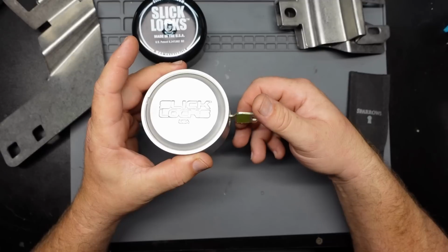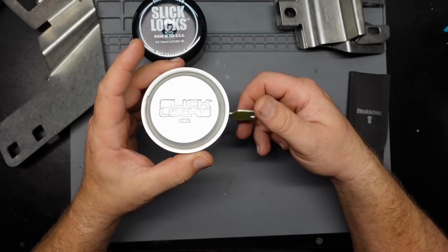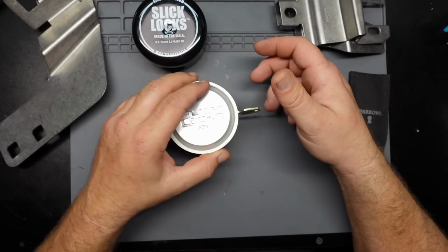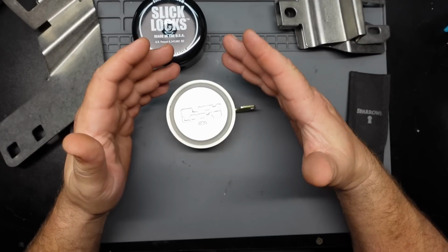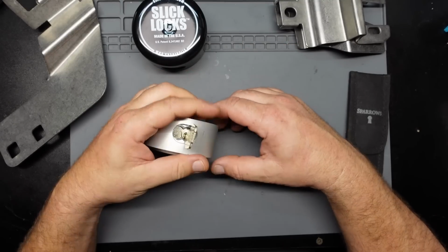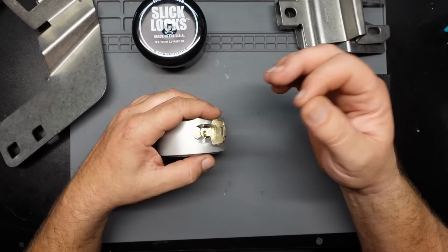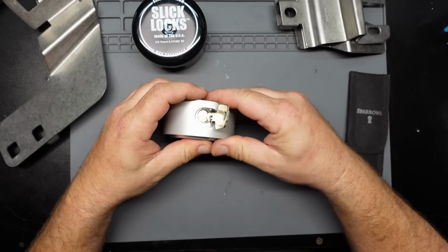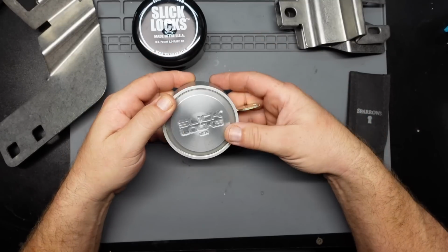But getting to what I was actually talking about, this lock, as far as I could feel trying to pick it, there was definitely some spools in there, which would be security pins, and they basically make it so you can't just do a low brain attack on it, where you just kind of tension it and put a little bit of a rake in there and be able to rake it open. You actually have to have a tiny bit of skill to pick it.